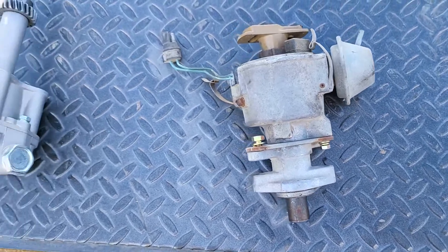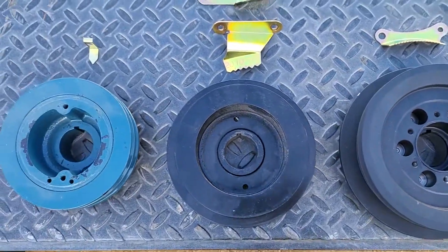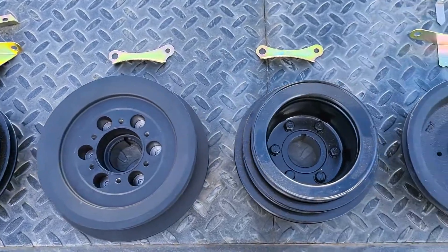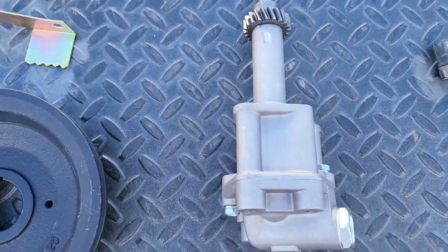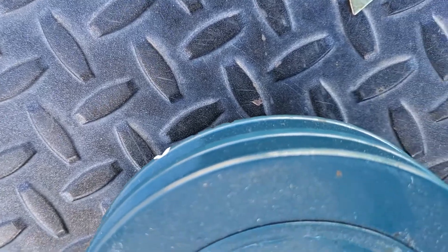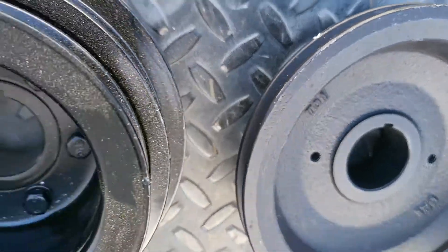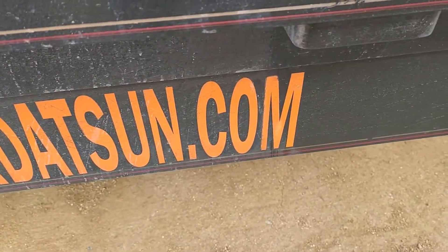I hope that clears up some confusion. I hope you have the correct timing indicator for the type of pulley that you have — if you don't, you're going to have a series of problems. It's a smart idea to take a pen and mark the top dead center indicator, which I've done to all these pulleys, as you can see with just a little white mark. It makes it much easier when you've got your timing light. I'll follow up with more information showing how to get that oil pump gear drive in the engine at top dead center. I wanted to explain these parts while they're off the engine just to give you a better view of which one is which. Thanks for watching.